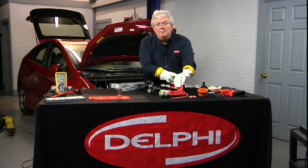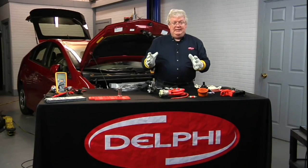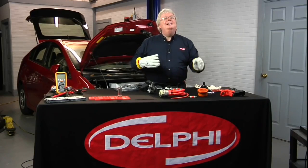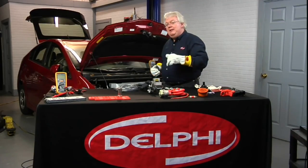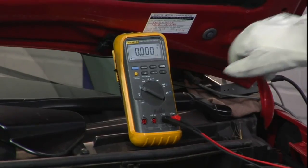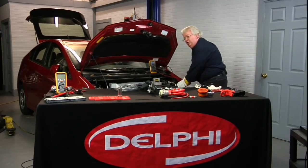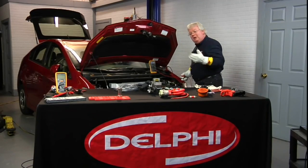What we're going to do is take our meter and turn it to DC. If the engine's not running we're not producing any AC yet, so let's go ahead and turn the meter to DC — which it is right now — set to DC. And now we're going to check the meter to make sure it's working okay.